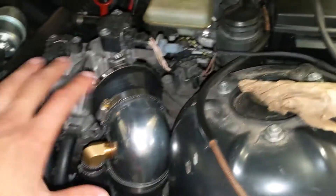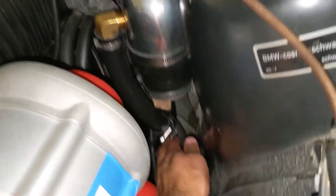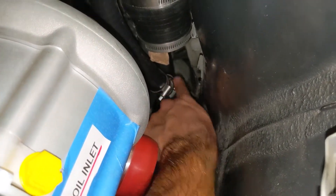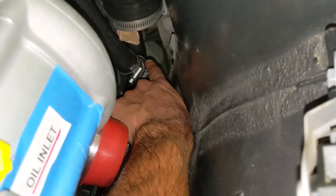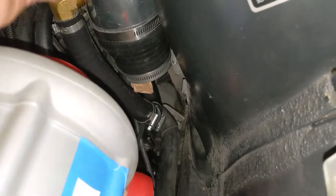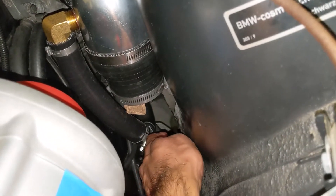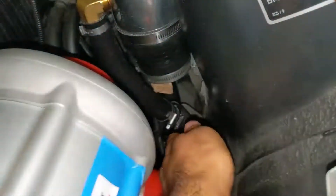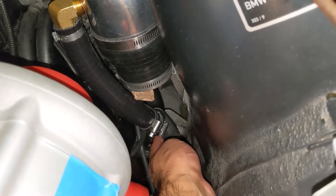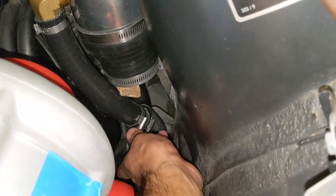When I put this hose back on, after I cut everything and filed, for the idle control valve hose, make sure you get that bracket on the old hose — the old hose is back here. They gave me a 45, so before you put this elbow in, reach down there and get the extension connected here. Then make sure you get it all the way down on the 45. You can use a 6mm ratchet because of the tight space to get those tight.